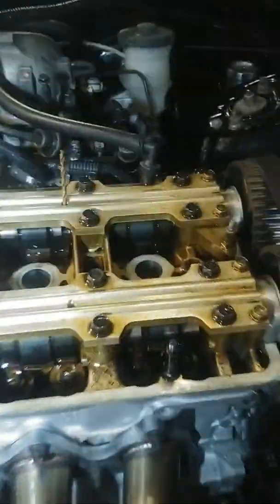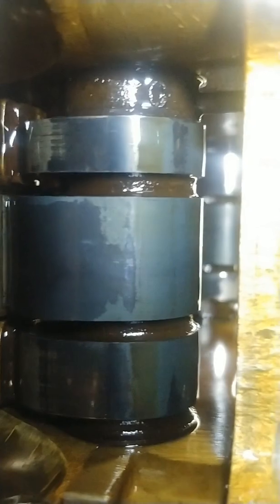So if you look at Type S cams — anything really that was made by Honda — they made it easy for you. You can see there's no hole on the right, but if you look on the left there's actually a small hole. If you get the right size, it'll fit in perfect, just like a dowel. So I go find a drill bit or whatever that fits in there — it's pretty snug, just like a feeler gauge type of feel. So what it's going to do is hold the cams stationary, because it has this top hole — that's what those top holes are for. They're on the opposite side. Same in here — if you look down in there, you can see it. I can move my fingers out, same with this one. So what that's going to do is — we're going to loosen off the tensioner down there, 14mm. Once we loosen off the 14mm, we can pull this belt off. I'll loosen it off so it's easier to put the new one back on and get this all cleaned up. I'll show you how to install everything here.